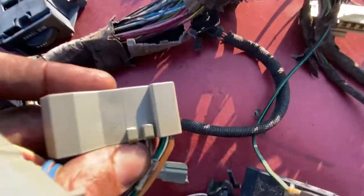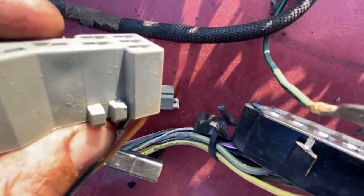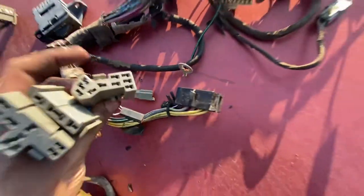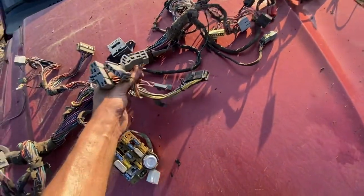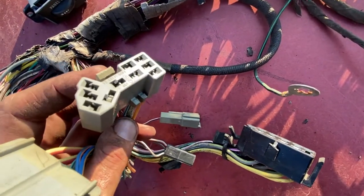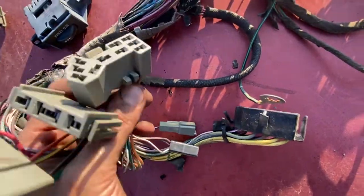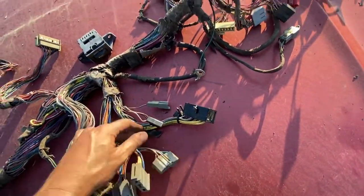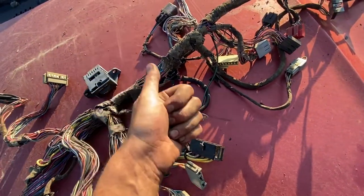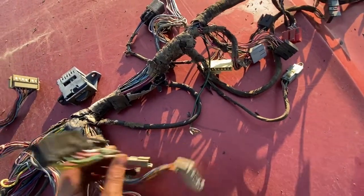I just noticed a broken clip — looks like there's dirt in it. I'm going to say that was done before because I was pretty careful today taking that off. It's one clip and I don't think it's worth trying to pull out eight pins to replace it for that one clip — I'm sure it'll hold just fine. Apologize about the five of this and five of that, but it is a 30-year-old harness. Another place people usually tap into for power is out of the ignition switch, and this one — winner winner chicken dinner — no molestation whatsoever. Nobody tapped into it, nobody did an amplifier from it, nothing.